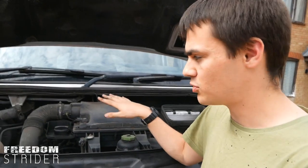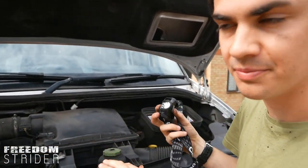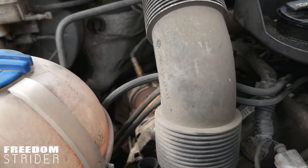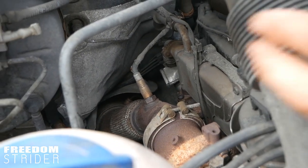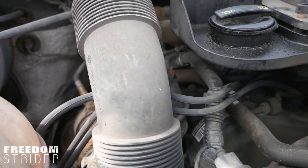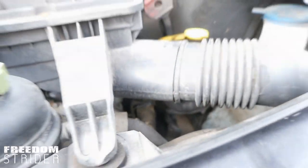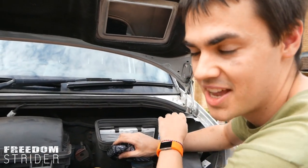After checking all the liquids, check whether they are leaking. Spend about 20% of your time looking for leaks above the vehicle. Grab your torch, put it on full setting, and look around for any wet patches — oil will dry out and be black and caked on. Look underneath all the reservoirs to see if anything's dripping down, got a drip on, or is wet. Everything in this van looks dry, but leaks drip downwards, so 80% of your time looking for leaks should be spent under the vehicle.